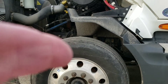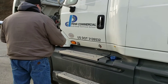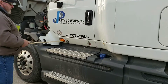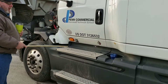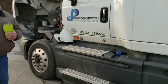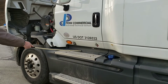Then you start down the side — mirror brackets, all in good condition. When you say your marker lights, what are these? They're a right turn signal, a left turn signal on the other side — these are hazard lights and they're marker lights. All will have to be stated. You just can't say that's a light — it won't get points for it because it has more than one function. Steps secured, battery underneath secured.